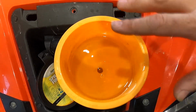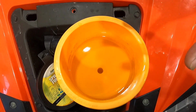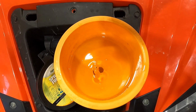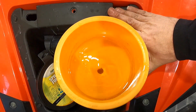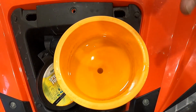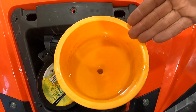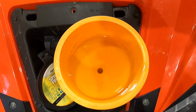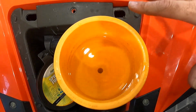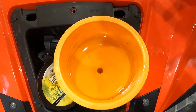So I'll sit here for quite a while and I'll let this keep bubbling, and then let the fans kick on a few times, let it circulate. I'll let it cool all the way down and watch the level drop, come back to it, and then we'll go ahead and check the oil to make sure that we don't have any water going back into the oil. And you'll be able to see vice versa here if the oil was going into the water right now. So I won't keep you guys watching this forever. I'll shut you off, come back after this thing's ran for quite a while. I'll let you know how long it's sat here running for.